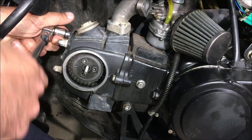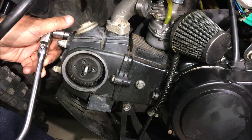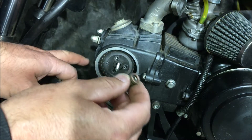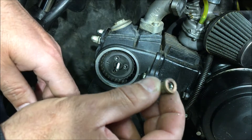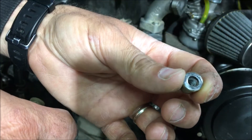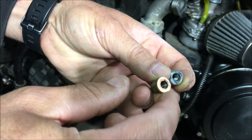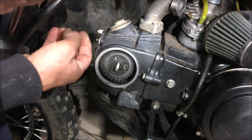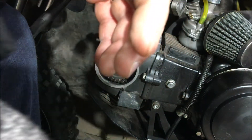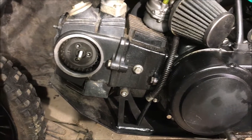Nothing snapped, so we take off that cover. Now, this is made in China — so here you have a seal. There's oil, so it's good to have a seal. On one side they have a copper washer to form a seal, and on the other the one I took off looks to be a stainless or metal washer, which doesn't form a good seal. Copper will squash out and anneal toward the shape of the roughness. Anyway, just throw them in the bin.